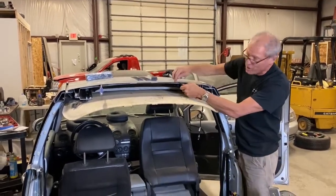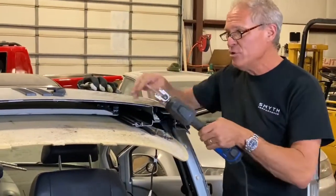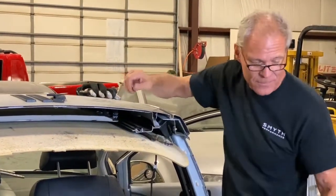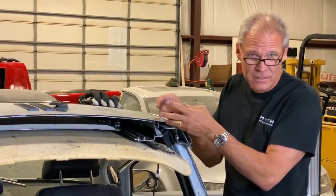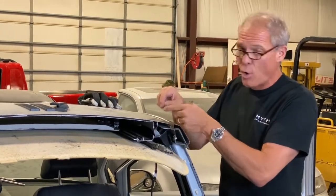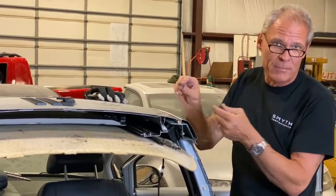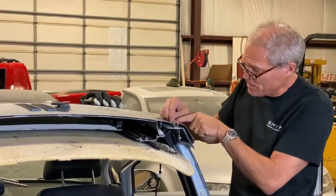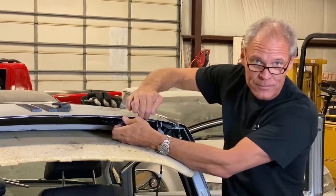All you need to cut this line — I don't use the Sawzall. You can use the Sawzall if you're going all the way through, but you'll have little burrs and stuff that you have to do bodywork on later. Preferably, you've got a circular saw with either an abrasive blade — like the kind you use to cut bar stock — or a metal cutting blade that you go very slow with. You can set the depth of the blade maybe a quarter of an inch and line it up, see where it's going to go.